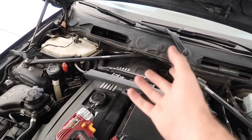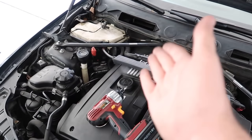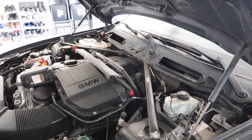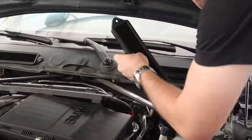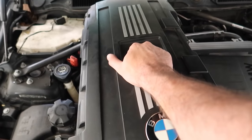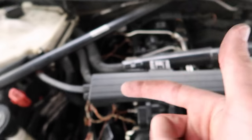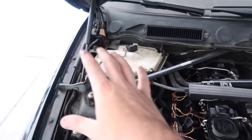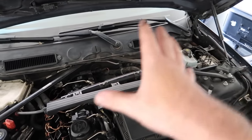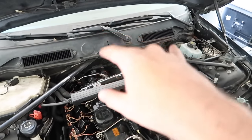We just got everything off — all we have to do now is put in the two cowl filters. This is already looking a whole lot better. I can easily access the rear ignition coils and rear spark plugs — super nice because we're actually gonna have to do the spark plugs pretty soon. Now that we have the cowl filters both installed, look how easy it is to access. Whenever you're hearing some kind of misfire, take off the engine cover — doesn't even have any bolts — and you can easily access things or hear fuel injectors going bad. If there's an ignition coil or spark plug issue in cylinder four, five, or six, you'll be able to easily access it without removing everything.